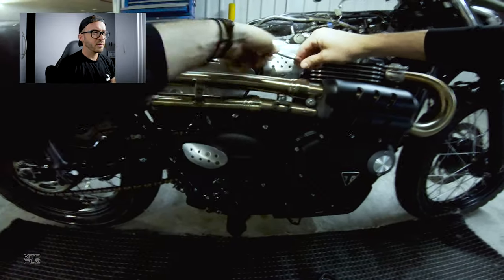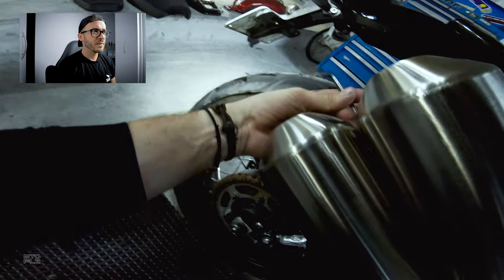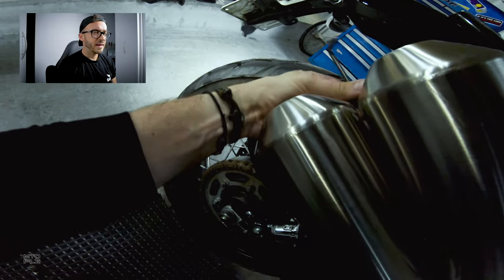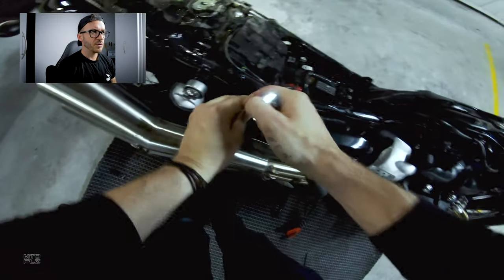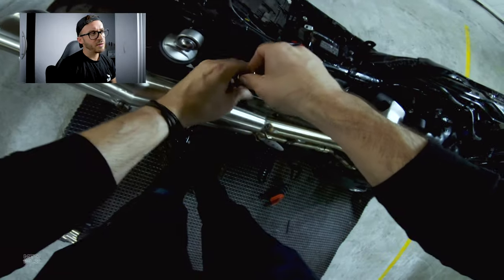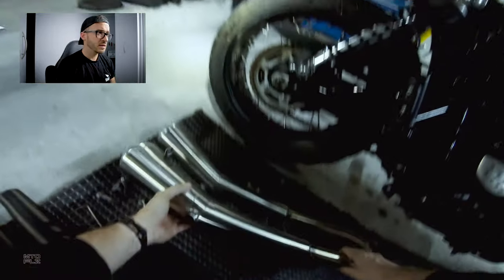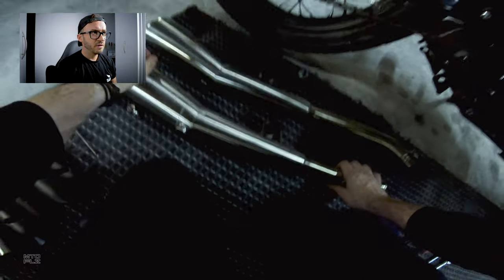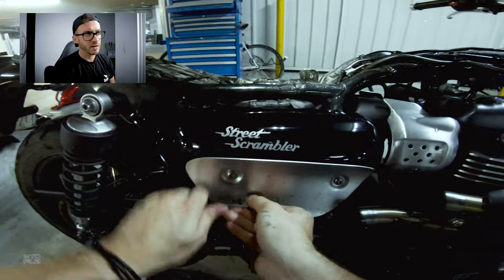There's also the two clamps that you have to do at the front there. Undo those, very simple. One cheeky one at the back. Yeah, just pull that straight out. Boom. You've got two 12mm bolt heads, unscrew those. Just be careful, they have sleeves, they will fall also. Slide the cones off, just take a mental note of which way around they're going.